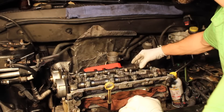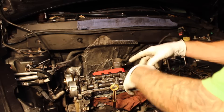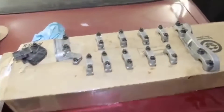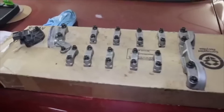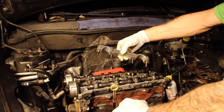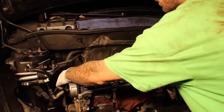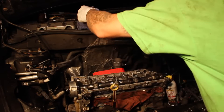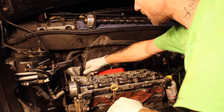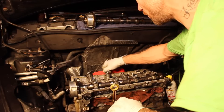Be very careful. You can go ahead and cut out a piece of cardboard and smash these things into it so they hold right in line if you want. I have them on a cardboard box — all taken off and placed on it. Go ahead and take this cam gear strap and put it right there, then put your cam caps back on and screw them in just so you don't misplace them or drop a bolt into the head.